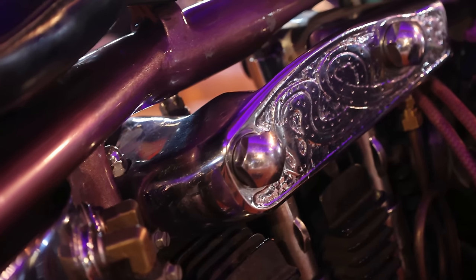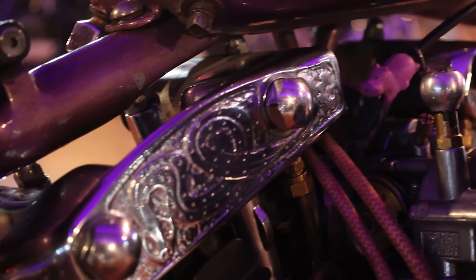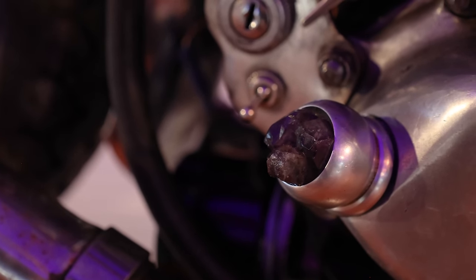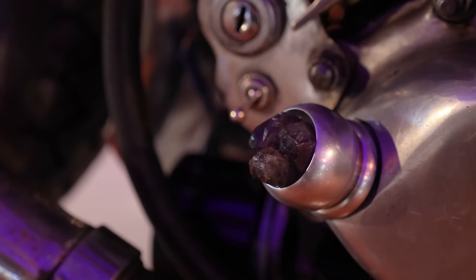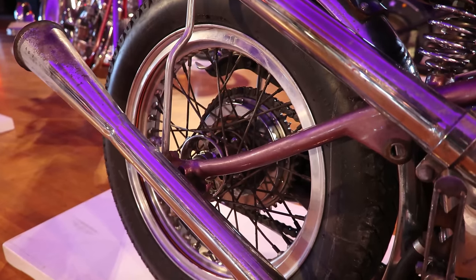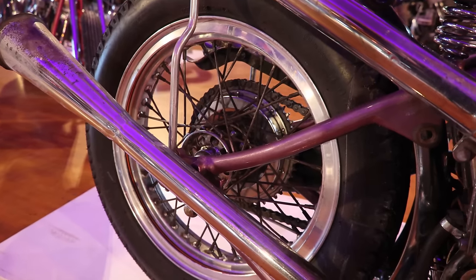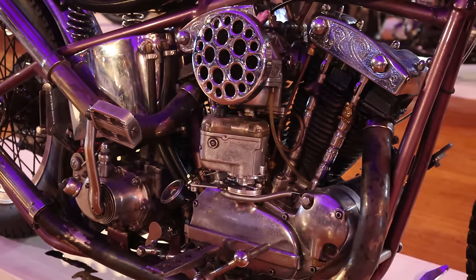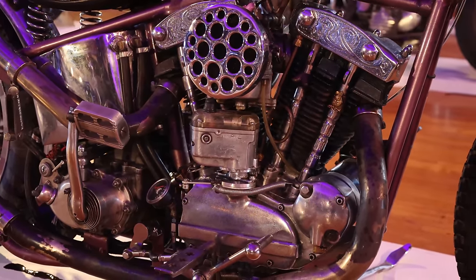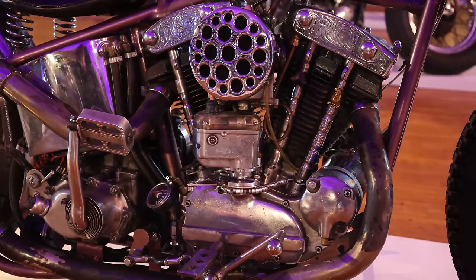A lot of guys are trying to do wheelies and treat them like dirt bikes, which is fine. An Ironhead's a peppy little dirt bike thing, but they'll blow the transmission, clean out the bottom. So one way to get around it was to do this divorce thing. It was popular in the 70s, and then you didn't really hear about it after that, but there's quite a following for it now. I've done it. I've taught numerous people how to do it. There's even a company that sells the parts to do all of it.